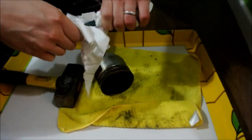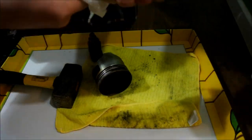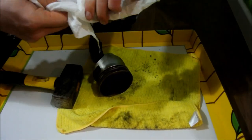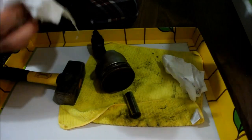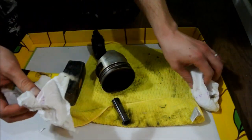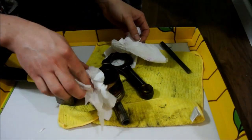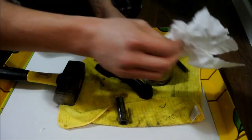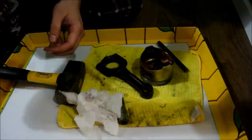And there you go — one piston wrist pin, fresh out the oven. Well, not really an oven, but you get my point. I just have to get my little plastic thing that I used to hammer the wrist pin out. There's the wrist pin. Once the wrist pin is away, you can just take the piston, take the connecting rod, and separate one from the other — voila! There's the connecting rod, there's your piston. This was pretty simple and that's pretty much it. Thanks for watching, please subscribe and enjoy.